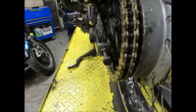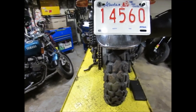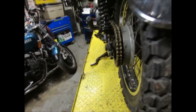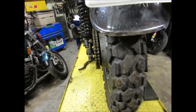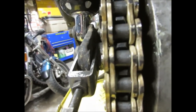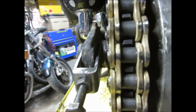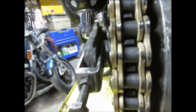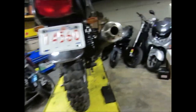If you're not sure how to adjust your chain properly, that's not as crazy as it might sound. The best verification to check if your chain is more or less where it ought to be is to look down the middle — if the teeth on your rear sprocket are more or less equidistant and proportional in the middle of your chain, then it's more or less where it ought to be.